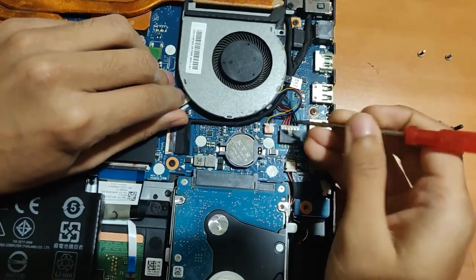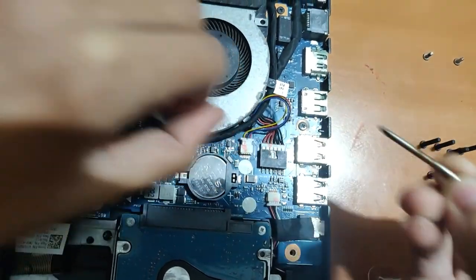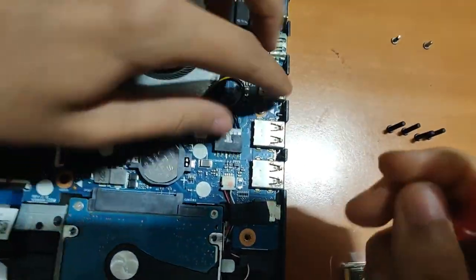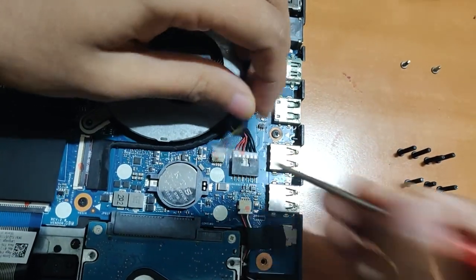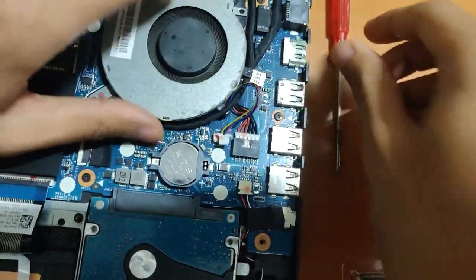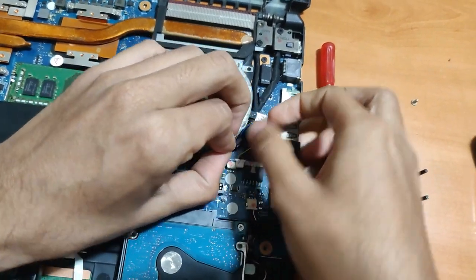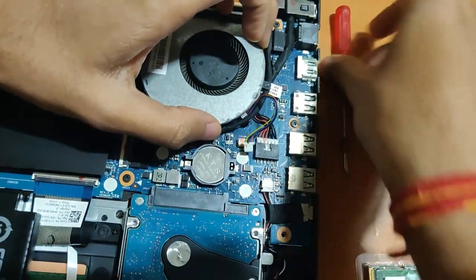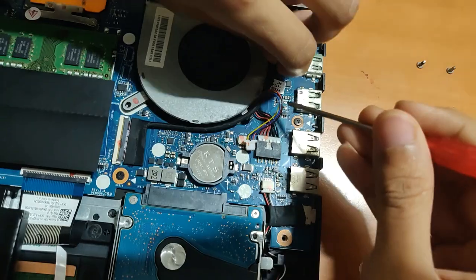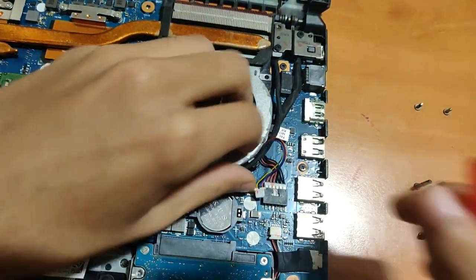You can see there are two panels here — remove the smaller one slowly. This is the power supply cable for the fan, so slowly remove this. And do not remove that other connector. After removing this carefully, just move the wire out of the way.